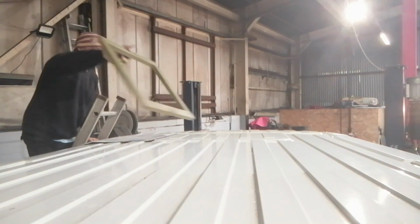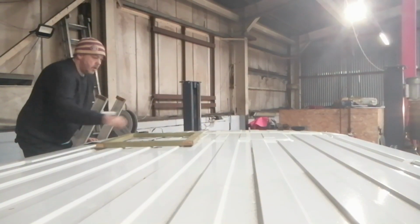I don't want any hassle today, no crap with this thing. I just want it to go in nice and easy. Cut the hole, file around the edges, I'll whack some metal paint around the edges, let it dry, and when that's drying, I'll attempt to drill one of the other holes. That is the plan. I do have the frame already cut out and all glued together and screwed together. I'm actually looking forward to fitting this.